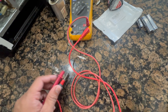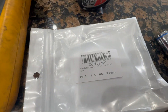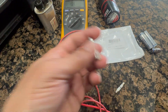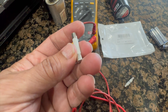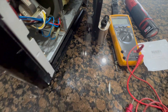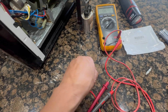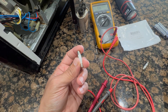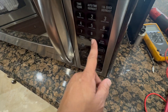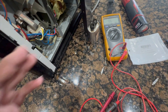I ordered a set of fuses — they come in packs of 20. I installed the new fuse, plugged the power in, and everything was up and running. But remember, if your fuse blew, something else is wrong. I powered it on, put something in, pressed start, and the fuse blew again — that confirmed something else is going on that's pulling too many amps.